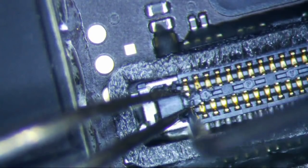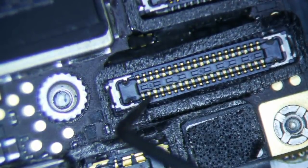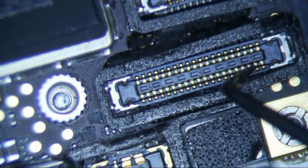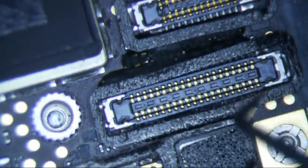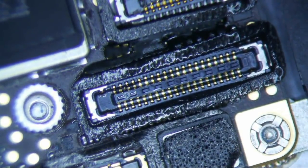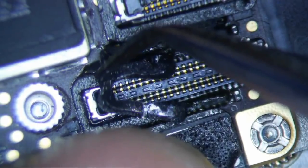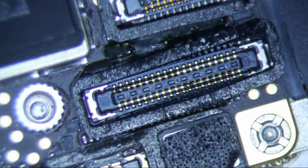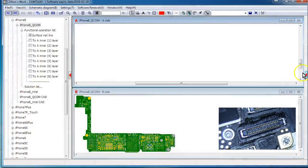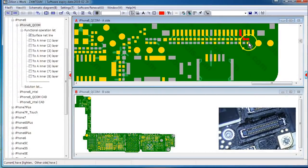Let's go back to the no display problem. This is the LCD backlight connector right here and everything looks fine. What I'd look for is this row of pins on the inside — if any of these are pushed in or not. They all look like they're protruding just a little bit, so that's all fine. The next thing I do is take a little isopropyl alcohol and swab this right here — just 99% isopropyl alcohol. Wait like two seconds and then lift. I've already taken it off, but as you can see there's a little thing that's gone right there — that's pried off the board. So I'm going to say 100% that is probably a display line.